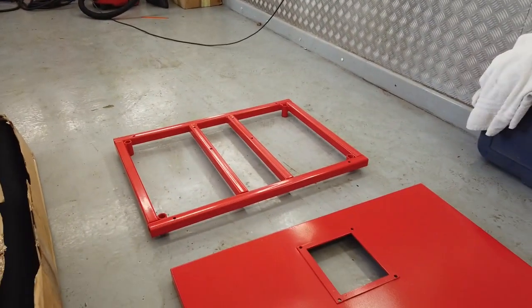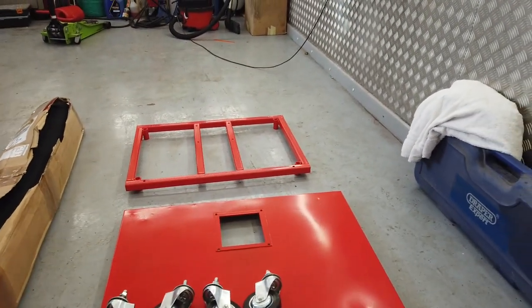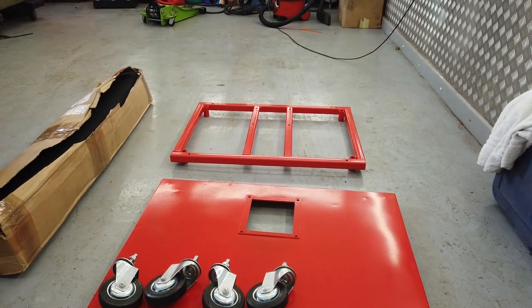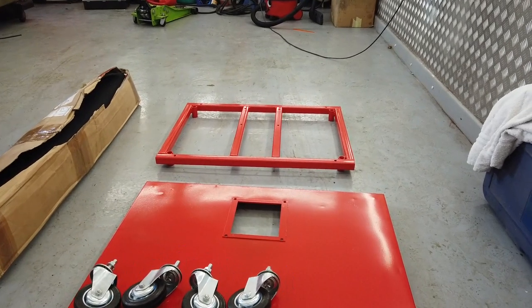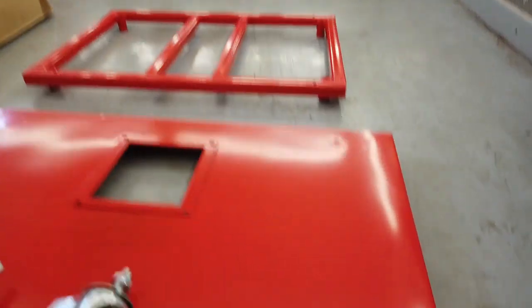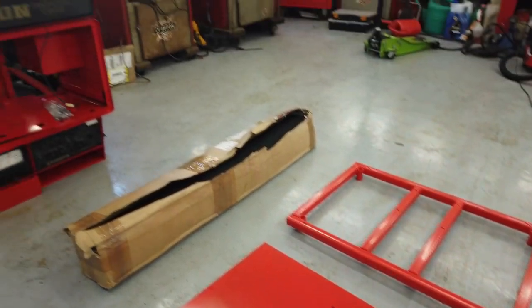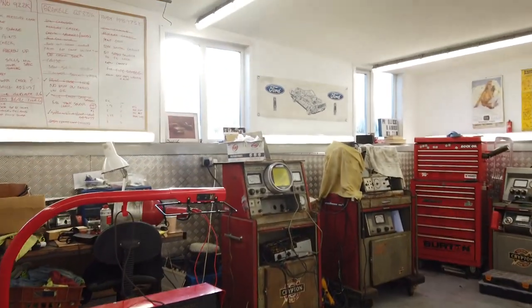It's okay though once it bolts up, but you've got to be careful with your shot blaster. A good one on solid steel, good box section, you'll be all right. But on smaller parts, thinner metal and large unreinforced panels, the shot blaster can warp it with the heat and the impact of kinetic energy there. So you've got to be careful, and that's the reason why.